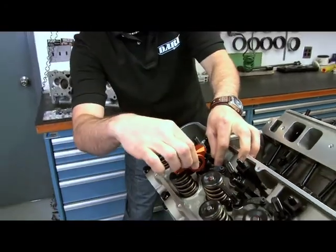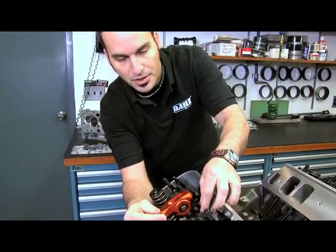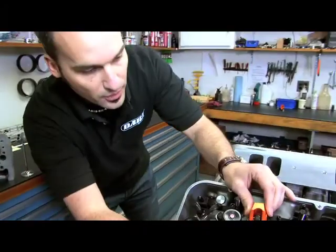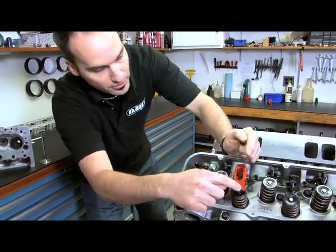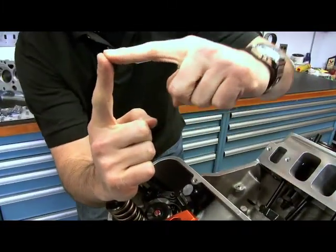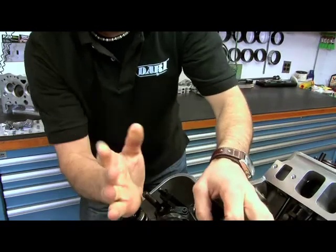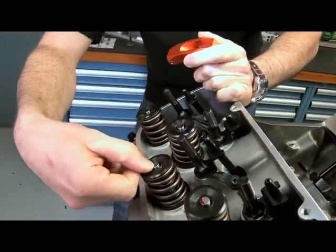The pivot point on the rocker arm is right here in the center. If I change my pushrod length, I'm effectively changing my pivot point and the angle I'm creating with my valve tip. What I want to do is sweep through about 90 degrees between the arm pivot. That's going to make sure I've got my angle to start with as I go through the motion, about the same angle at the full length of travel, and back again. I also want to make sure my load pattern lands right about on the center of the valve as I sweep through its motion.